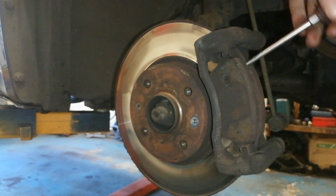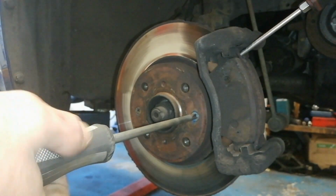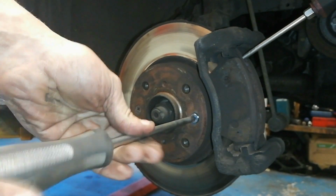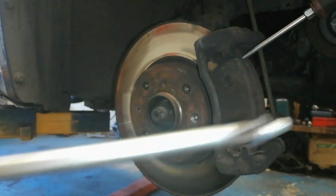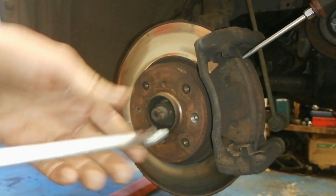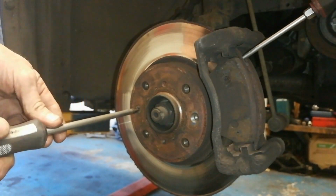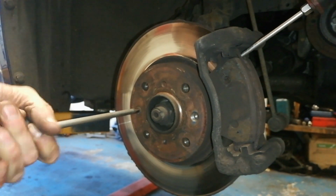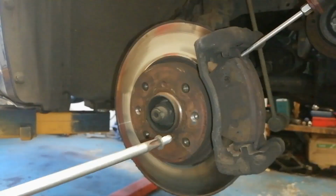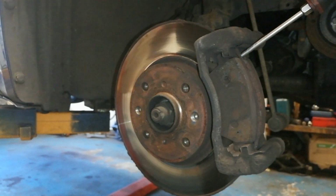So you take these screws out, I'm just gonna jam the disc. Before I take the carrier off, I'm just gonna jam the disc in there, and dead easy. And that stays on that because it fits perfectly. That is the screwdriver to do those crosshead screws. They are not Phillips screws. And we'll just do this other one. So there we go. I haven't previously loosened them up or anything like that. So if you put a Phillips screwdriver into that, you'll just burr it and wring it, and it'll cause you all sorts of grief.